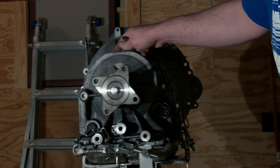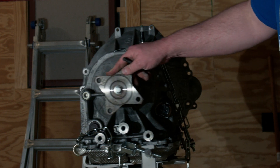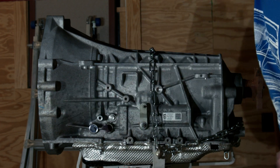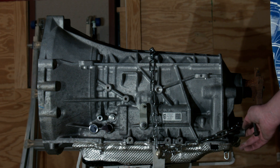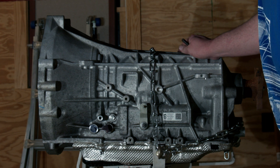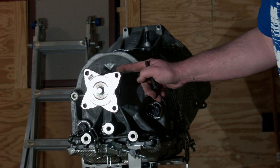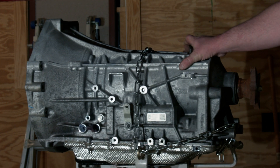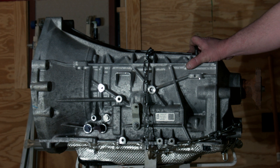The trans mount setup on the 10R80 is just like a 6R80, and dimensionally it's about the same length from the bell housing — so if you have a crossmember that works for a 6R80, it should work for a 10R80 as well. The flange on the back is the same as a 6R80 — the four-and-three-quarter-inch bolt circle that Ford uses a lot now. That's in contrast to the 4R70W which had a slip yoke, so a telescoping driveshaft is needed.